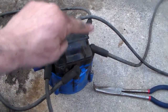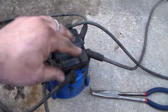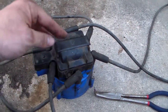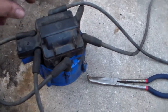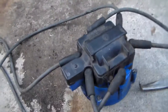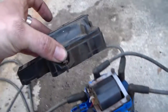Normally you're going to have a circular ring here that snaps into this plastic cover — I don't have that on this one. I've already pre-loosened the fitting to make a more efficient video. You have two quarter-inch screws, one here and one here. You loosen these up — I used just a regular nut driver — and then this just lifts up and pulls off.